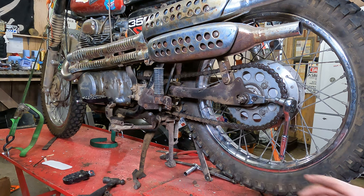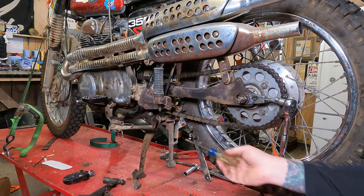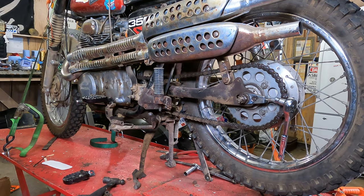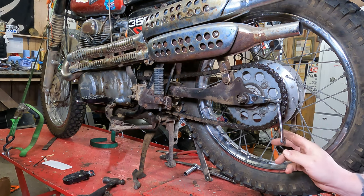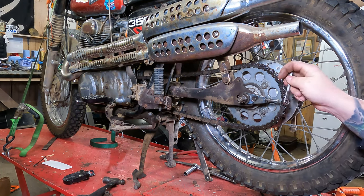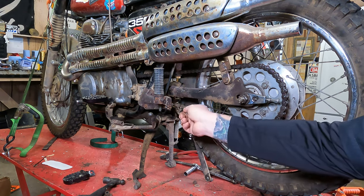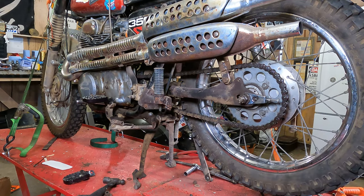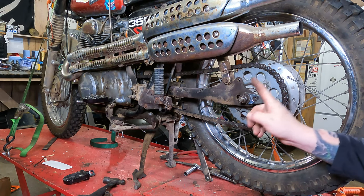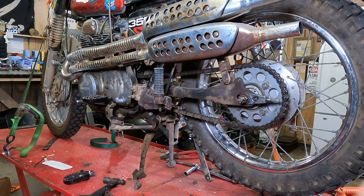The big thing you're really after is you just want to take the slack out of this, but like I demonstrated, you just want it floating on that film of grease — you don't want it guitar-string tight. So we're only going to go a little bit tighter than that. To help maintain alignment, you can use a wrench and do it evenly — start with the wrench at six o'clock, go to twelve o'clock, so one half turn here and one half turn on the other side. Now we'll check our tension — that's sitting pretty solid, a wee little bit of sag, about five-eighths to half an inch, set at ride height. From there we can torque down our rear axle, put our cotter pin in, and lock these jam nuts to hold the axle adjusters in place.